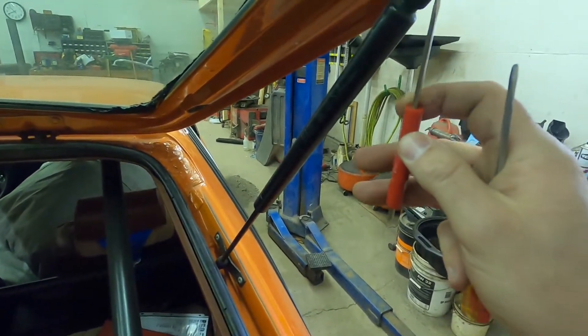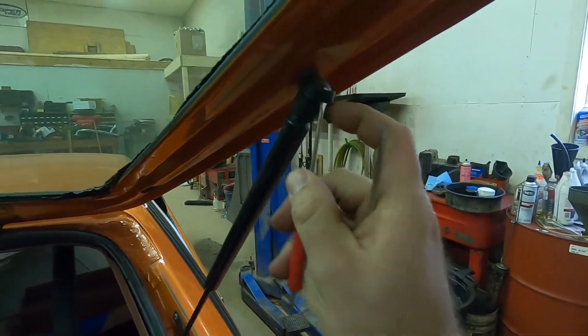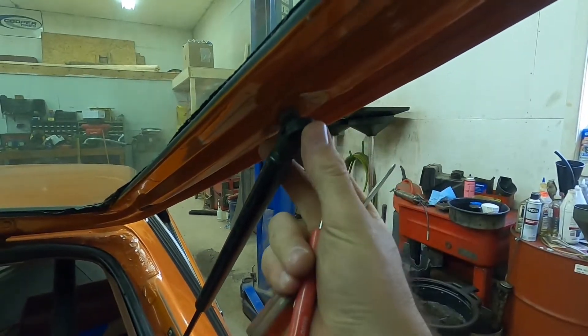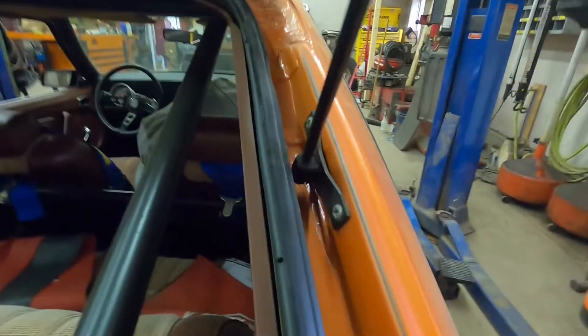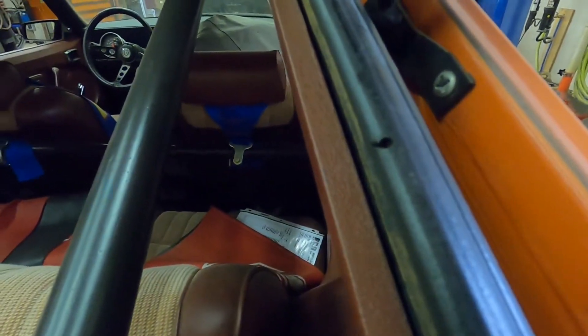To remove these quick struts is very easy. All you have to do is take a small screwdriver and basically pry this spring tab out of place. You don't even have to pull it all the way up. There's one at the top and one down at the bottom. Because of where the bottom one is, I'm going to set the camera off to the side.